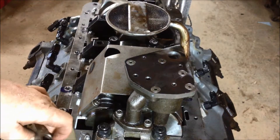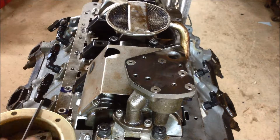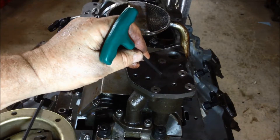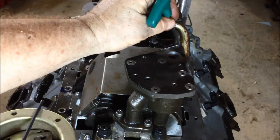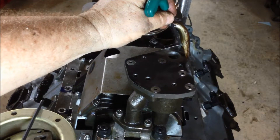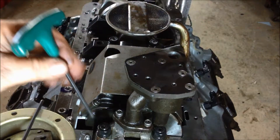Because I believe everything needs to be done with more than one purpose, this plate, while it's also an adapter plate, I ran it out and it's just got a little point here. It's going to have a little tack weld on it — that is going to be a support for the tube. So everything fits out real good.